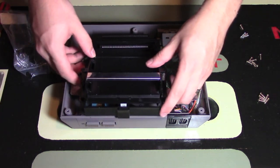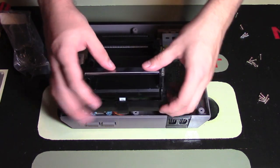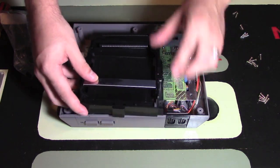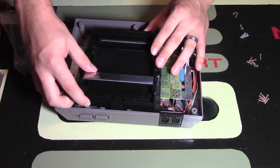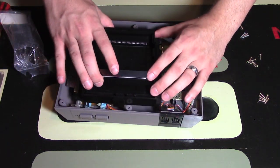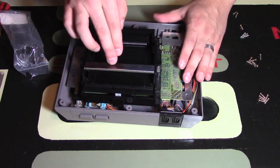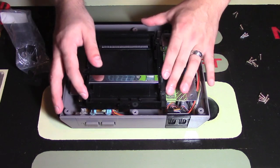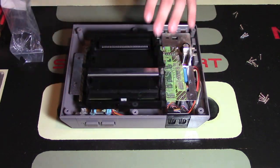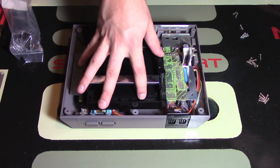And this piece, you're hopefully going to be able to wedge it right back in, and you don't actually need to use any force. If this is down, I'm told it's supposed to make it a little bit easier for you, but in the end, as long as you can get it back. So there we go, it's coming back on, and you put it all the way fully back in its place, and then the mechanism, just make sure that's still working, obviously. Now the screws, I'm going to put back on the 4 screws that are important, because they have to go back onto the motherboard.